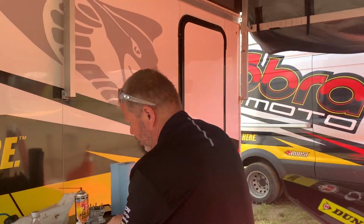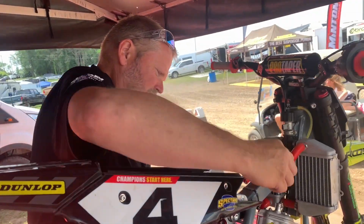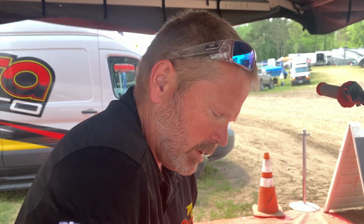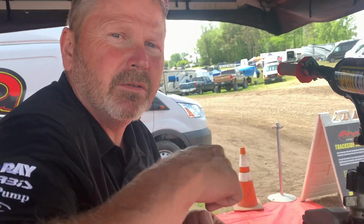What was that for? Just to make sure everything's good, rings are all good, everything's moving free and easy. If it feels any kind of tight or resistance, it's probably something's wrong. Take it back off, make sure it's right. It's steps you don't want to screw up on. It could cost you a lot of money and a lot of extra time that you don't need to spend.